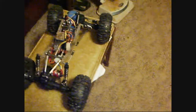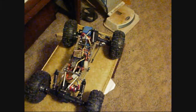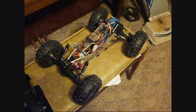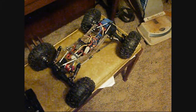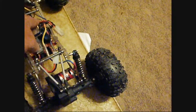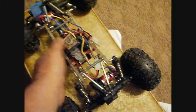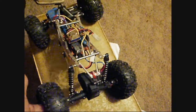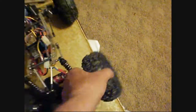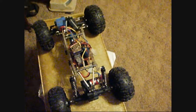Lost some of the droop — I liked the droop. But I think a lot of that droop was because the Spark shocks were completely dead. I just beat them up, I can't get them to have any damping anymore. The Wraith shocks at least have a little damping — they got a little slowness to them. Not a ton of it, but I'd really like it to be slower. But what can you do?